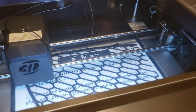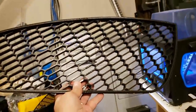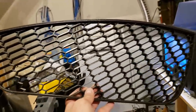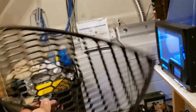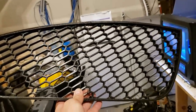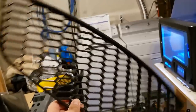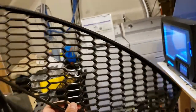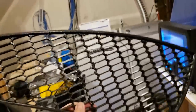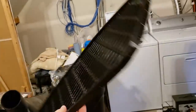Before we go into the beauty room, we're back in the 3D printing room — we've got a print going on here. This is for the side intake grill. We had to do a couple of prototypes before we got one that fits nicely. This is made out of ABS, and I've had one sitting outside for six months through record August temperatures, so I know it'll survive direct sunlight. When it's finished, we'll clean it up, give it an epoxy layer, and shoot it with some 2K — but for now we can just put it in raw.